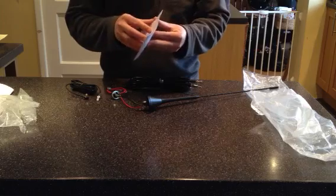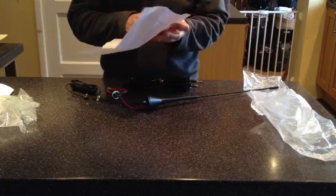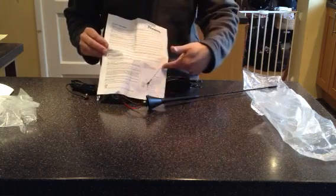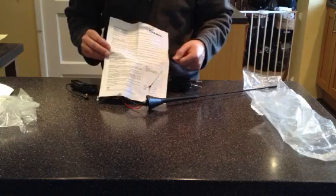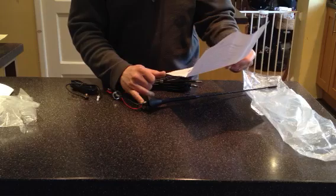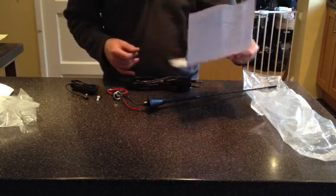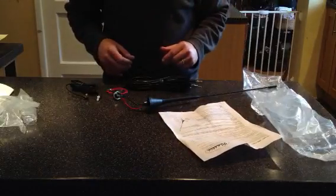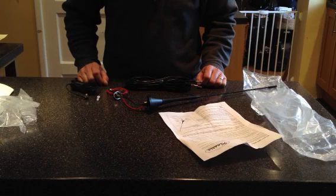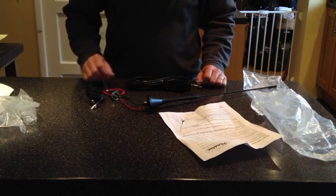That's what that says there. These are the instructions. You can find some details of these on the Dab on Wheels website, dabonwheels.co.uk. The instructions are here. This picture here can be found on that website and will show you the connections on the base, and will also tell you the size. The hole required here is a 19mm round hole, just so you know. There's more information on that on the website. And I will also be posting a video of the installation of this aerial, so you can get an idea of how it actually goes in the car. So that's the Kinetic DRA-6001.